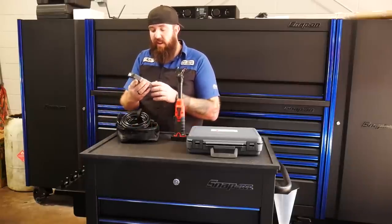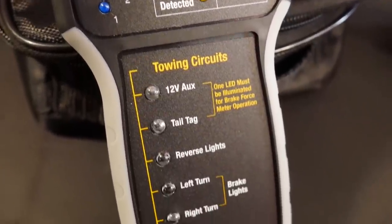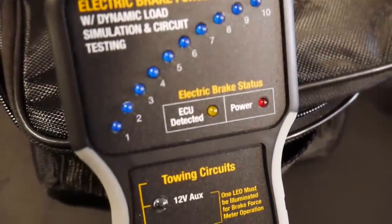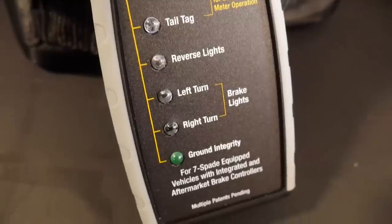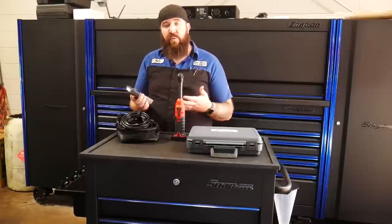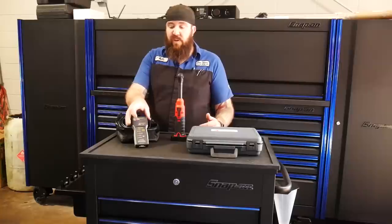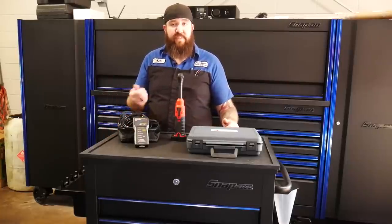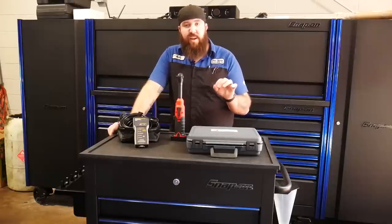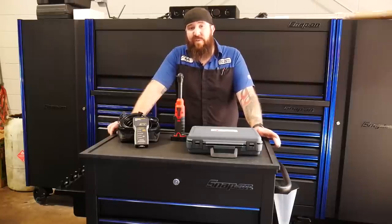When you plug this thing into the unit, it's going to light up whether you have your 12-volt auxiliary power, and it's got all the other indicators for your other lamps as well. Your ground integrity — you're going to see that light up really nice and bright if you have a good ground. It also has a little section up top just to the left: it has your ECU detected, which is going to be your CAN bus and your pulse width modulation feedback, as well as the power to that signal. The pulse width modulated output of these brake controllers is very dependent on a load. When you hook a simple seven-pin LED tester up to a newer truck, it's not going to have the correct output reading — the trailer brake indicator is just going to be slightly flashing because it can't read the pulse width modulation and it doesn't put a load on the system.